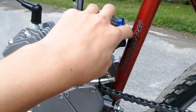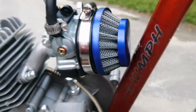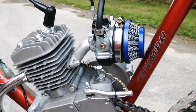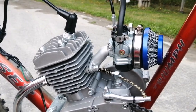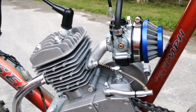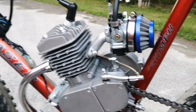These carburetors also tend to come with a better air filter that allows more airflow without getting too much dirt in the engine. Obviously, you'll want to oil it somehow or keep an eye on it. The third reason is that this carburetor, instead of a needle adjustment, actually has pre-drilled holes inside of it — I'll throw up a picture. As you open the throttle slide, it uncovers those holes, and you can really fine-tune them. For example, if your bike was running a little too lean on top, you could drill that final hole slightly larger before it gets to full throttle, and that will allow more fuel to be pulled through.